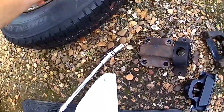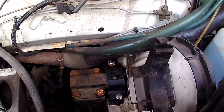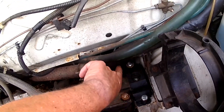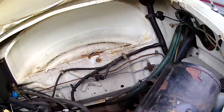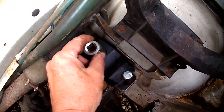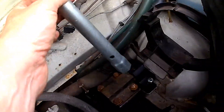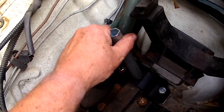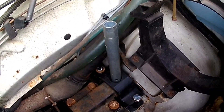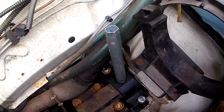That's it mounted. The one at the back can be a bit of a problem because of the fuel pipe filler. The other awkward one is this one here because my sockets won't go through this hole, but what I found will go through is a spark plug spanner — it's not the correct size but it should be able to tighten it up. It's raised the engine quite a bit in the engine compartment, which just shows you how much the old one had sagged.